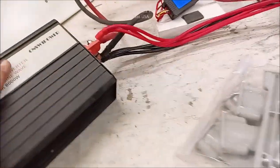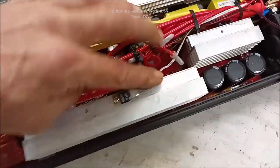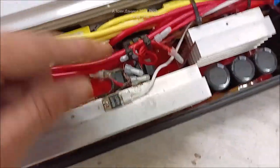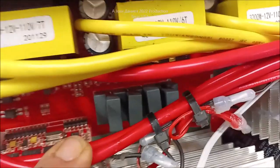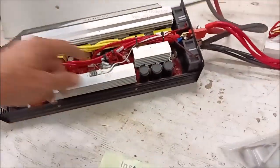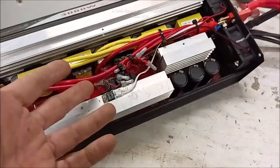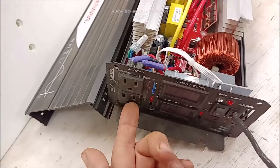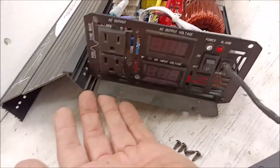The second thing I told them was the load-up capacitors weren't very good. I actually burned one when I got something stuck in the fan. Those little capacitors are sufficient, but if you run the unit under a high load for a long time you don't want one popping. So look what they did — they're on steroids now. Same rating but instead of 180 volt capacitors they've upgraded to 300 volt. That's a real upgrade.